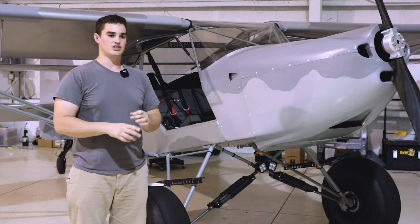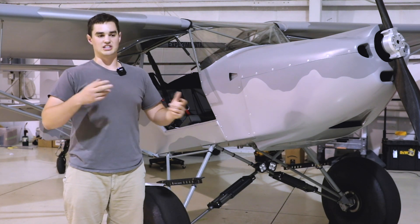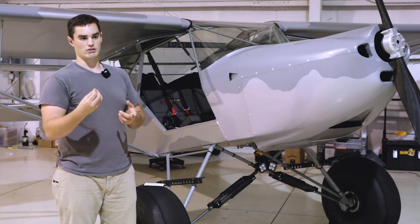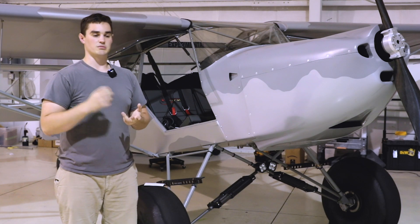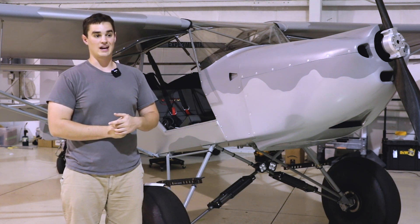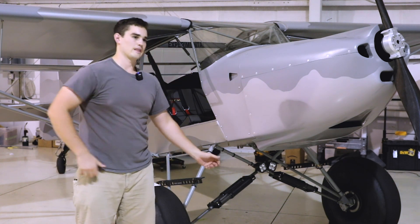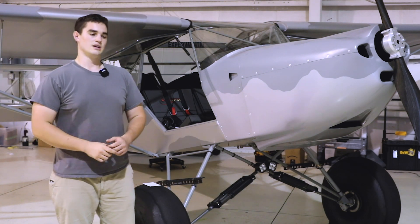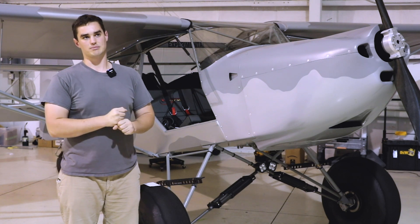Weight and balance done, the inspection went very smoothly. The inspector came, looked things over, gave some suggestions and issued my certificate. Almost all of his suggestions were related to the engine compartment — a cable from the Rotax wiring harness needed to be crimped tighter, some routing in the engine bay needed tidying so it wasn't flopping around, I added heat shielding to some oil hoses and routed other hoses further from the exhaust. He also noted my fuel caps didn't show fuel quantity or fuel type, so I printed up labels and stuck them on. Then he issued my certificate.